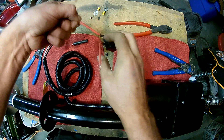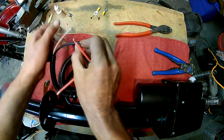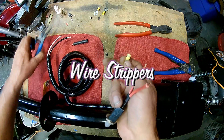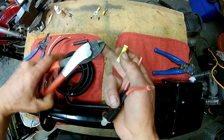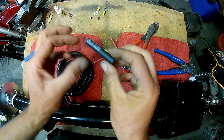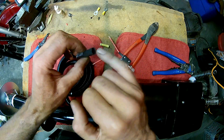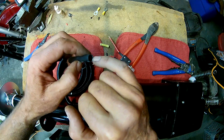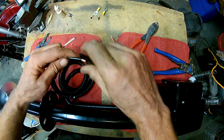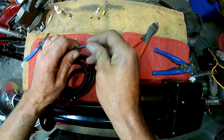You can pick up a wire crimping tool at any place that you get the wire terminals. I like the ones I've got here — these are strictly wire cutters, and then I have one that's actually my crimping tool, a little more expensive but I like the job that they do. The other thing I'm going to do is install some shrink tube over the top to help protect it. This particular tubing actually has a sealant inside, so once it shrinks over the top, that sealant actually helps make it watertight. This is going to be connected near the battery, but I still want to keep the heat and moisture out of the connection as much as possible.